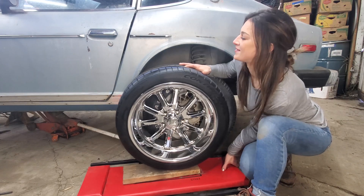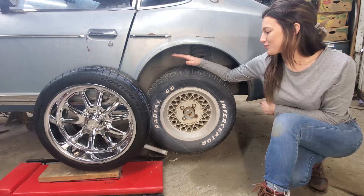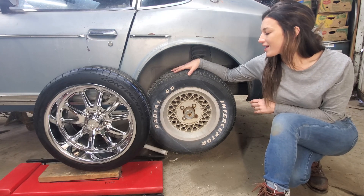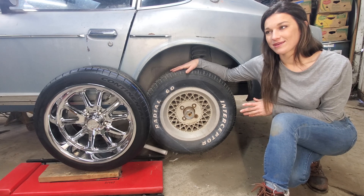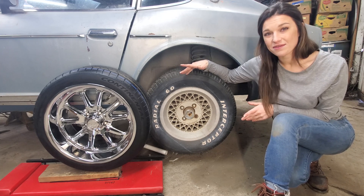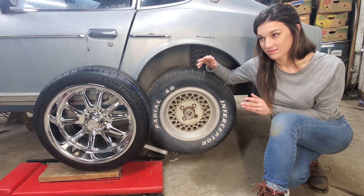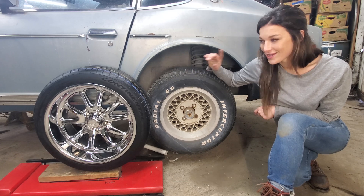These are a five-lug wheel and these are a four-lug. We don't expect this rear axle to hold up very long with the LS power, and if we are going to upgrade the rear axle when it eventually breaks, we're going to be five-lug anyway. So we figured if we're going to be buying rims, we might as well buy five-lug now and figure out the four-to-five lug conversion.